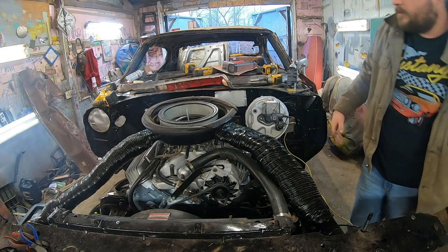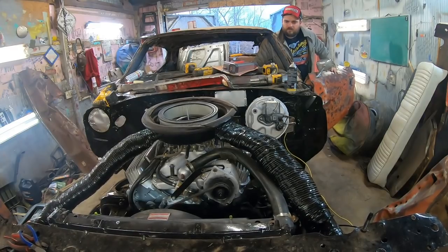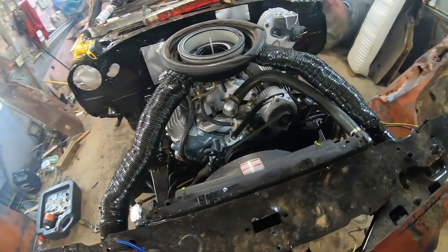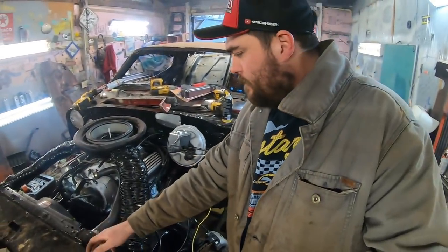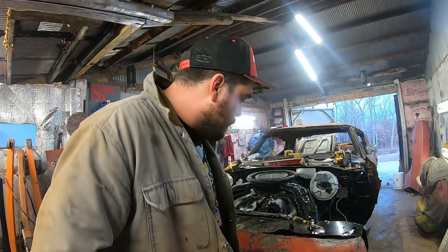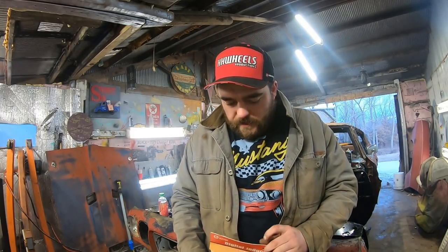We're going to have to tinker with it a little bit and get her dialed in so she'll run. Not fast! All right! Let's dial in that timing! Well, we know she makes joyful noises. We have it running — doesn't look like anything's puking out of it really. I know there's not enough coolant in it so I don't want to run it too long, but we can dial the timing in.